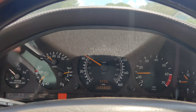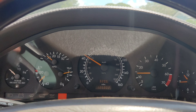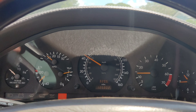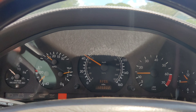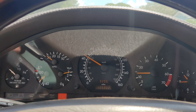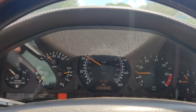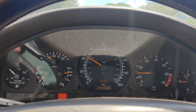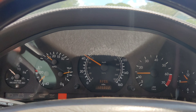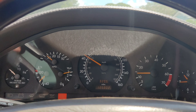Let's go ahead and pack it with some grease. This is the bearing grease I use — I used it on the 500SL too, works great. You can use any type of bearing grease. I went ahead and packed a whole bunch up in there. One thing I just realized is it doesn't have the boot on here. I'm thinking there's a possibility the boot comes on from the factory, but they do sell a boot that goes over that to keep the grease from drying out. So there's a possibility that somebody changed this out, didn't add the boot, didn't add the grease, and we're just getting some noise. Let's check it out — that would be really really awesome if that's just the case.